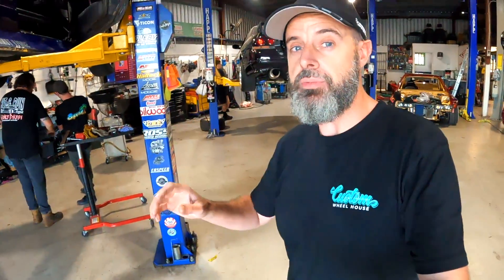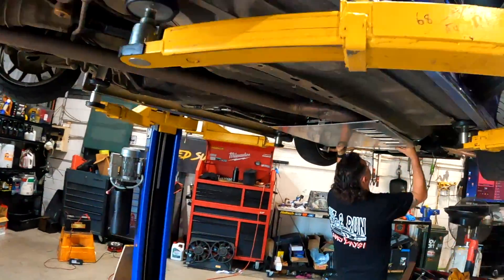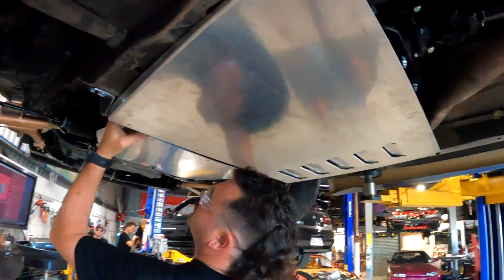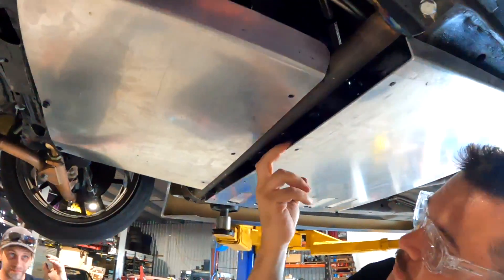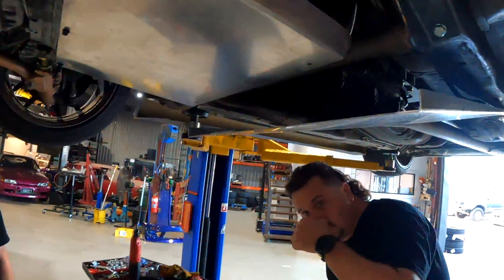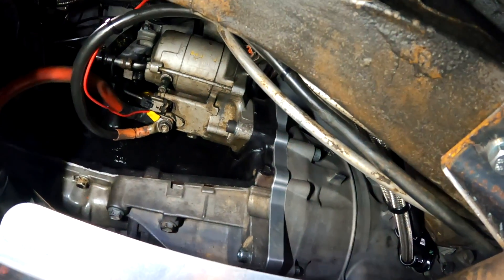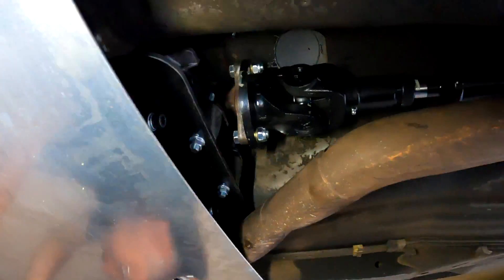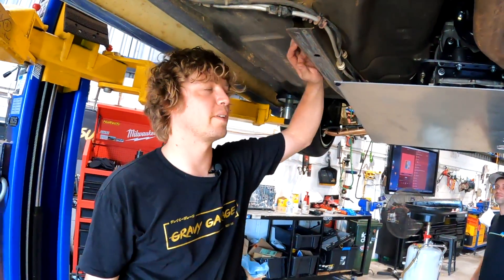We got the car back together, the engine back in, and then decided to do an eight speed swap - which is kind of why we haven't finished the F-truck. We'll get on to that in the next week or two. We've got Brock here finishing up a nice under tray or bash tray to stop anything hitting in front of the gearbox. We've gone for an 8HP70 - the N57 one. We've got one of the Domiworks 1JZ/2JZ to 8HP adapter plates, one of Brock's custom-made rear gearbox mounts, and a custom-made tailshaft.